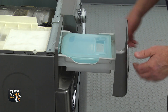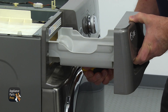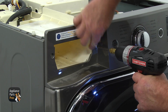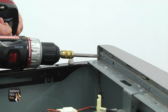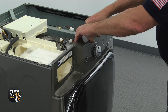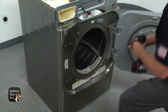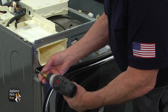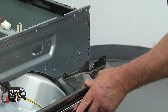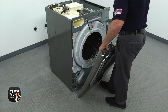Move to the front and pull the water tank drawer on the left and remove the water tank. Using the flat-blade screwdriver, press the locking tab up from underneath the drawer and take it out. Using a Phillips screwdriver, remove two screws, one on each side of the drawer opening. Move to the right corner and remove one more Phillips screw from the back of the control panel. Disconnect the control board plugs, pull on the top, and remove the control panel. Open the door and remove four Phillips screws — two at the top and two at the bottom. Next, remove the top Phillips screws that hold the front panel. Use a flat-blade screwdriver to release the catch on the top right and tilt the front panel about an inch. Disconnect the white and pink plugs from the door switch and the light, and remove the front panel.